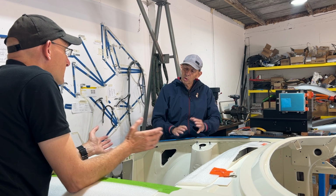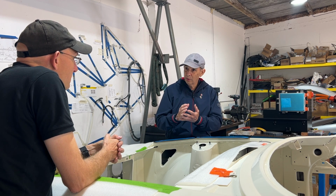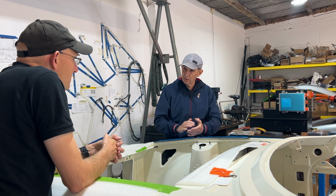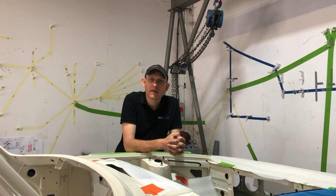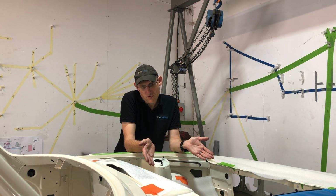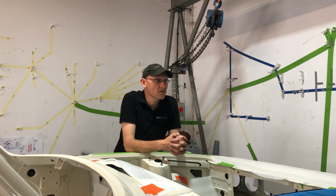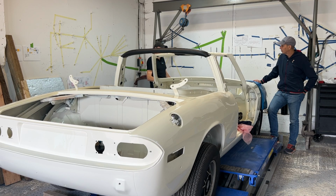Yeah. So what do you think? I mean, you know around the industry what's going on, but what do you think we're going to be able to get fast charging time down to, say, in 5 years' time? What's your best guess? Well, we could with this car go to sort of 200, maybe 250 kilowatt charge. Right. That's there today and capable for these batteries. The big problem with that is we'd have to cool the battery.